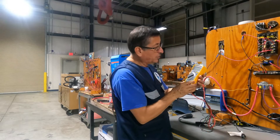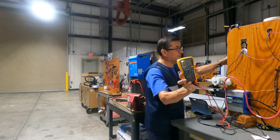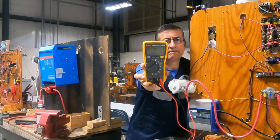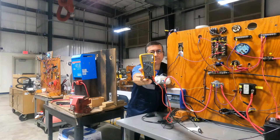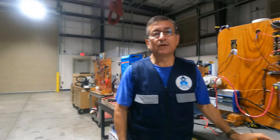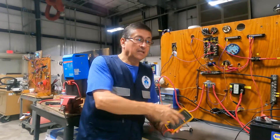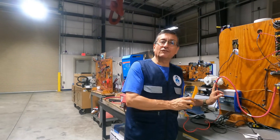Now we are going to read the voltage drop when I crank it. The voltage decreased to 11.74 volts. In this particular case we don't have a load, so the reading is good — it's accepted. But if the engine is connected, with the start motor linked to the flywheel and transmission, the voltage drop would probably be more. This is the process: read the voltage drop between the negative of the battery and the positive terminal of the solenoid of the start motor.